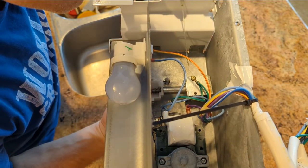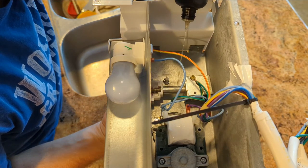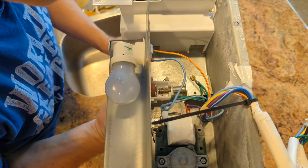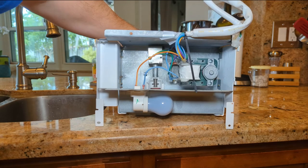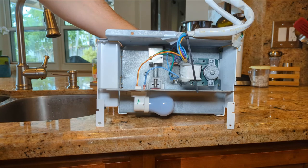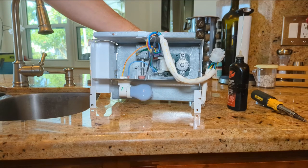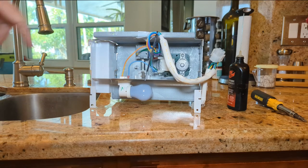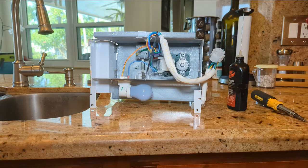I have no idea if this is going to help, but I don't think it's going to hurt anything. And it does move much more freely now - it doesn't get stuck anywhere and returns perfectly. Everything's come up to room temperature and I'm happy with how everything moves. There's no binding of any kind. I straightened out the solenoid - it was a little crooked but easy to fix. Just loosen two screws in the back and rotate it slightly. So now I'm going to reassemble and put the ice tray back in and see how it does.